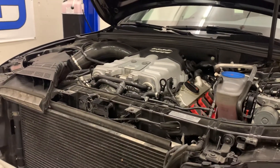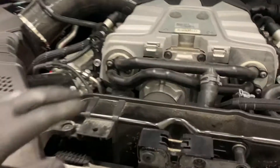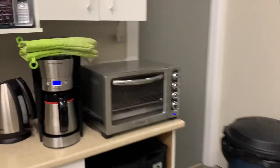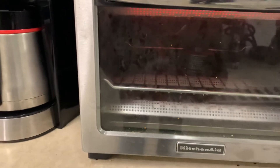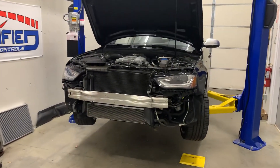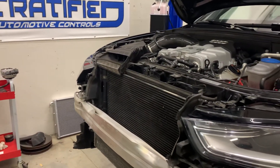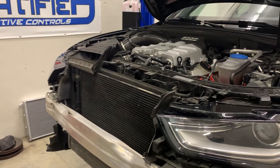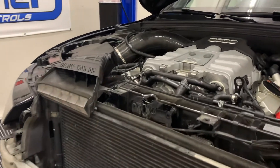There are a few steps here. First, you can change one or both of the pulleys. We're going to start with one — the top pulley here on the nose of the supercharger. We actually have that pulley right now getting ready to be installed — it's cooking in the toaster oven. It's a press-fit pulley, which means we have to get it really nice and warm so that when we pull the OEM off the car, that pulley slides on and then shrinks once it gets cold, making a tight, slip-free fit on the nose of the supercharger.